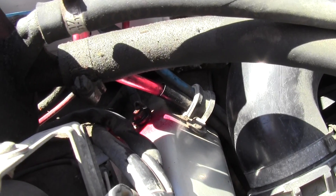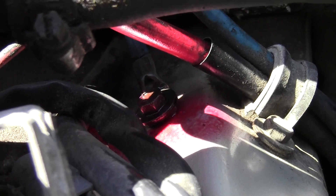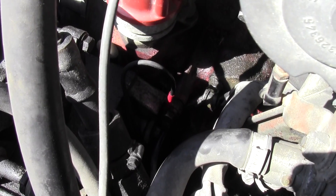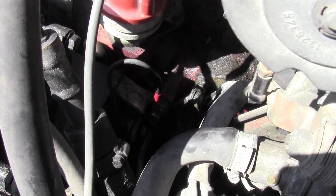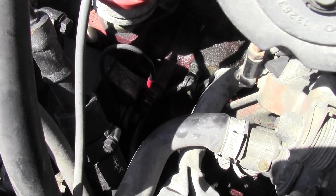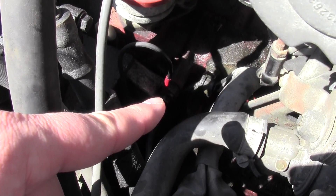There it is — that's a good shot of it right there. The next one is a little harder to see, but it's got a lead with a red part of the wire on it coming off of the compressor, and it also has the ground cable coming in there. That one was pretty oily, which could have also been the problem. I've got an issue with my flame trap system — it's kind of shooting oil on that side of the engine.